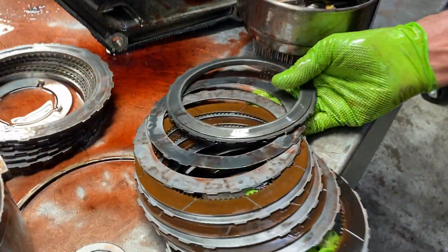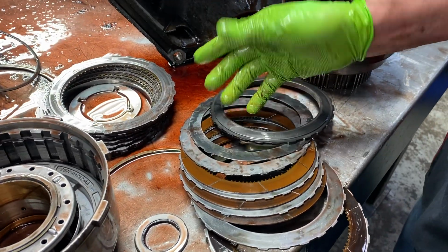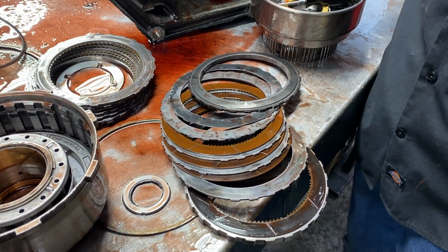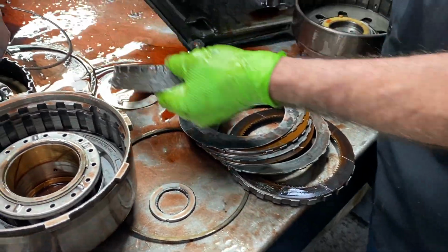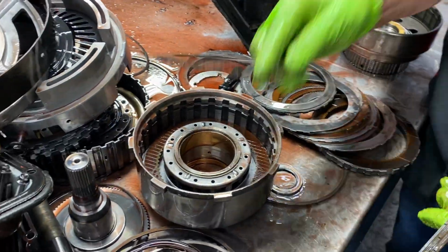Now here's our forward clutch. Now we do have a wave to soften the engagement. We don't ever take the wave out because you go back to customer complaints. A farmer puts in gear and it knocks his teeth out and his coffee spills on the dash and all that type of stuff. So we don't want that happening to the man. But we can take this forward plate right here and we can take, like this, guys, we can take this 3rd gear clutch. I'm going to build it back real quick and show you.